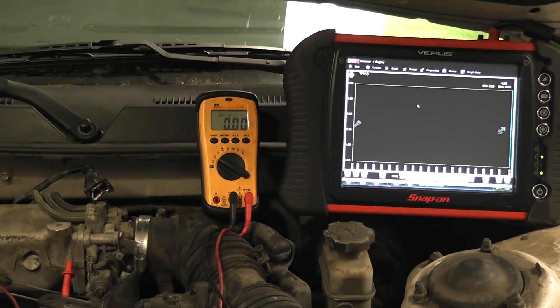With the resistor in place, it was 4.98 volts. Now you might be thinking, isn't that resistor causing a voltage drop? And it's not, because we're just going into the sensing circuit — there's no ground there, so no voltage drop across this resistor. The resistor is a buffer in case the signal wire is shorted to ground.